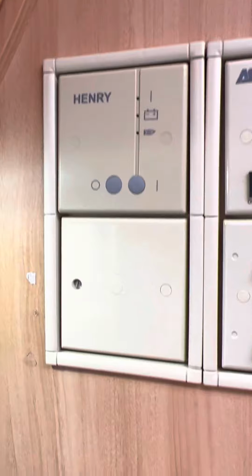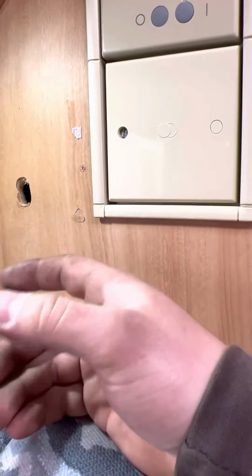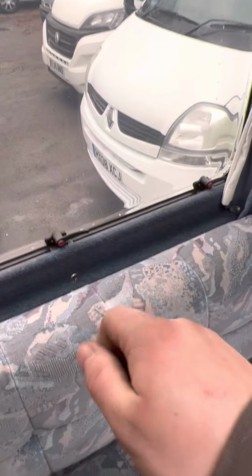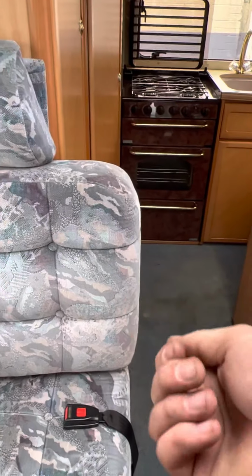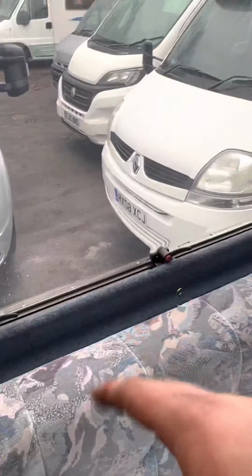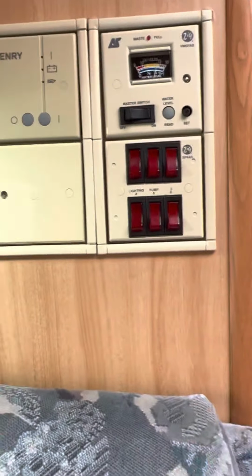It's a little bit more straightforward in this van, to be fair, because the only way to drain out your boiler is on the outside, with the big flathead screwdriver nut on the bottom left hand side to come out, and that's the only way you can drain that one out. So unless you've done that, you can know that your boiler's full anyway, because you know it's not drained out. It's only really on the newer ones that have got automatic dropouts and things like that on them that you have to worry about that so much.